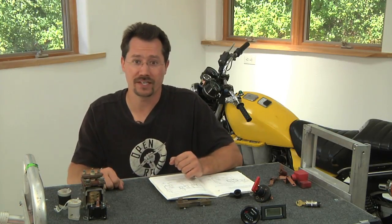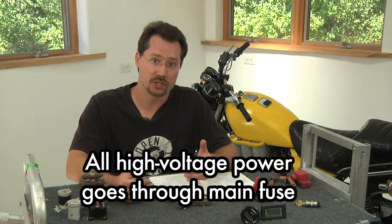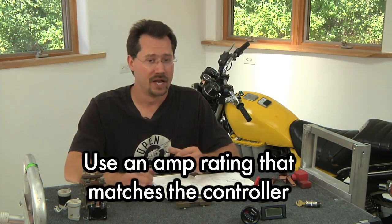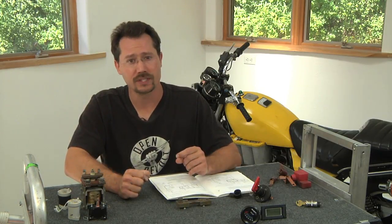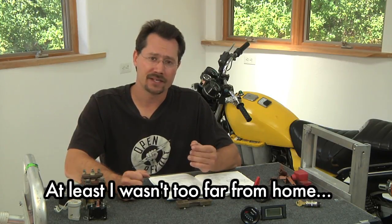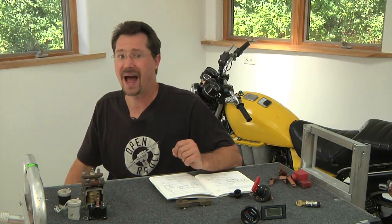The main fuse is pretty important. It's a device that fails in case you're pulling too much amperage. That's going to be rated the same as our controller — in this case, we're going to use a 300 amp fuse. All the power goes through this fuse. It's kind of the number one safety feature on your vehicle. You absolutely have to have one. Also, order a spare so that when you do blow the fuse you can replace it. Keep it on the vehicle and set up the fuse in a place where you can actually replace it when you need to. The last thing you want to do is design a fuse that's impossible to get to.